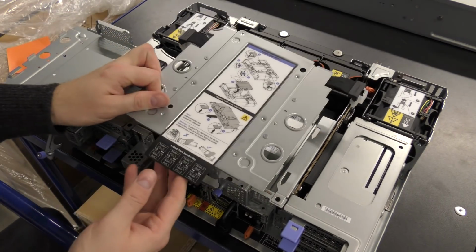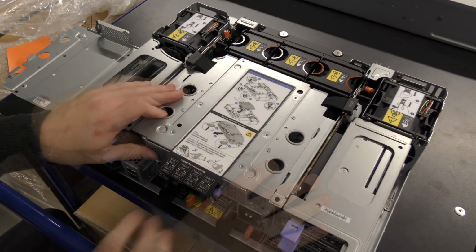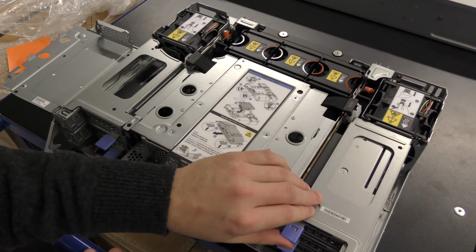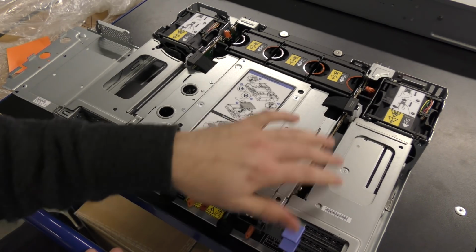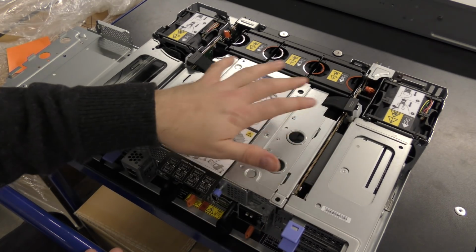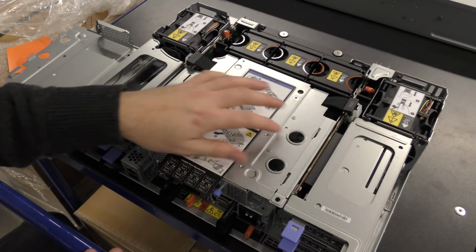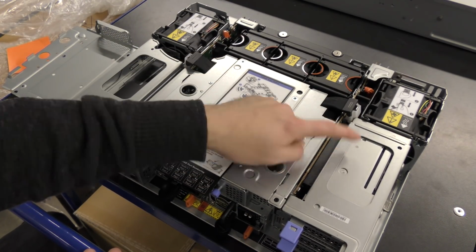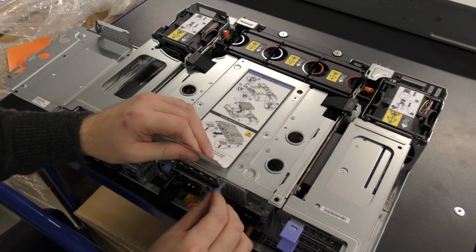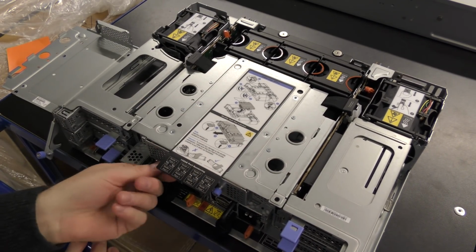Interesting. There's another shuttle available for this chassis, which is a little bit more manual. This one is pretty awesome, that you can actually power one server down and replace the PCI Express cards here. The other one, you have to pull all of this out. So if you need to remove or change a card or add a card, you have to power down the 4 servers that are running there. And you only get X8 connections instead of these X16s.